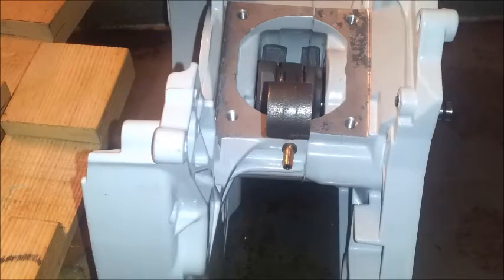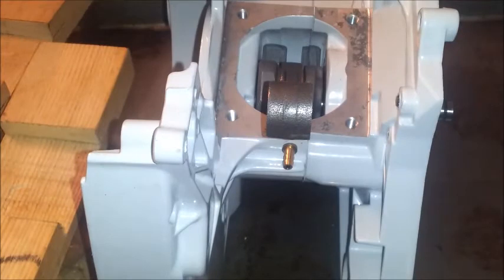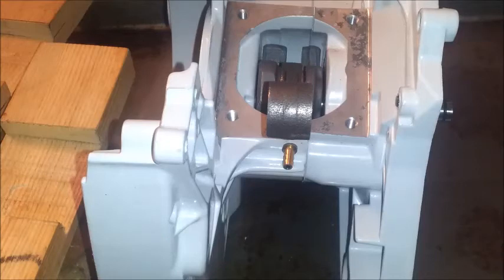What I did off camera, because there's no way to record it, was twisting and turning it to make sure the two locator pins were going in the holes. I flipped it over and dropped in the three main screws in the center and began to tighten them. I got them fairly tight and then went out to the peripheral area with the screws. And I gave it one love tap when it was 95% there.